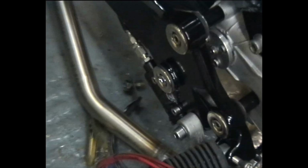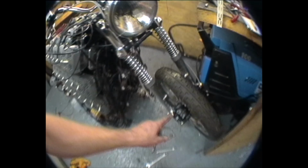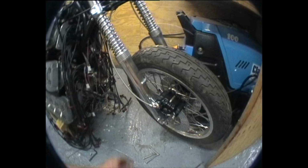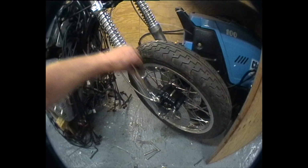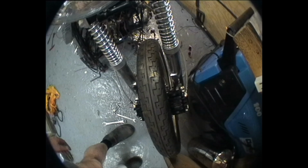But we've also done the front brakes, rebuilt them. I've just finished the Goodridge hoses, they've gone on rather nicely. These brakes went on that way and I reversed the forks, but of course what I didn't realise is that the fixings aren't truly central on the forks. So I have to space this side with a 1mm washer, and that side it just fits quite nicely actually.